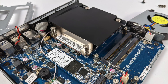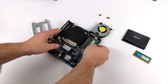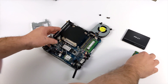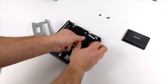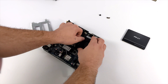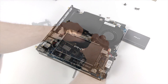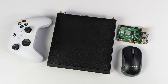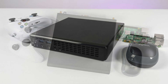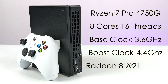Now that I have the CPU heatsink installed correctly, it's time to add the RAM. I'm using 16 GB of Crucial SODIMM running at 3200 MHz, running in dual channel. The blower fan goes right on top of the RAM — there are three little nubs to hold everything in place. I've also added that 2.5 inch SSD. Now I need to install Windows 10 Pro to the M.2 SSD. This thing is tiny — it is a thin little unit, and I really hope that the stock heatsink setup can handle this APU.